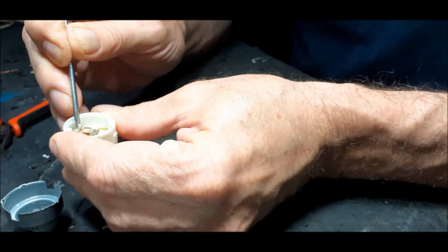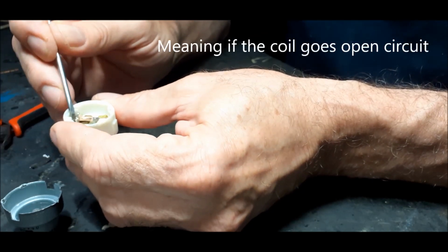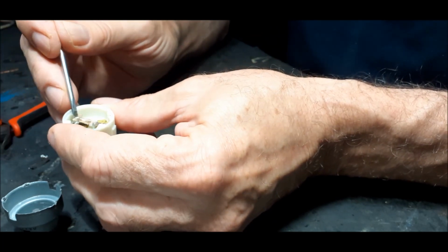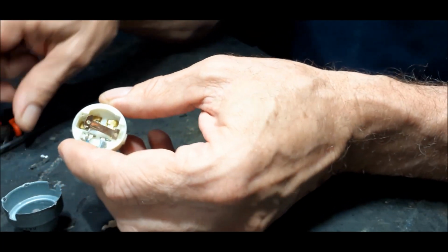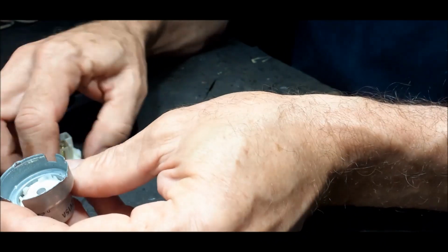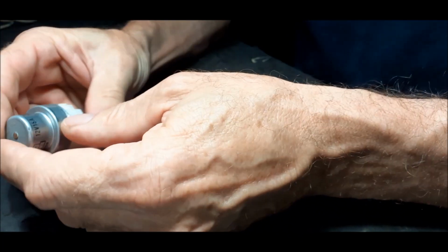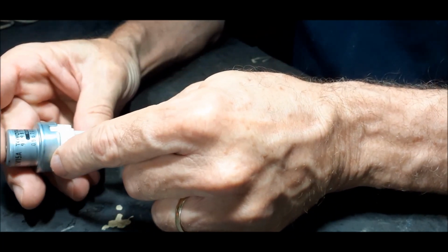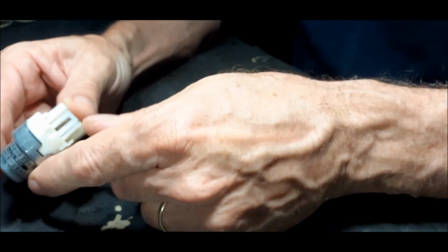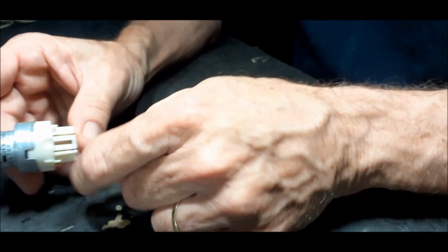They call it a fail-safe operation. If something goes wrong with the relay, it will always relax into the safe operation. It will let the fan run, otherwise your car will overheat. That's it. There's a lot of space. Rather take your old one to the Toyota garage to get the right code, to get the right footprint, if you want to replace it with a genuine one.